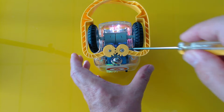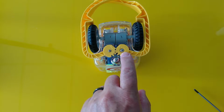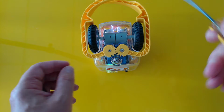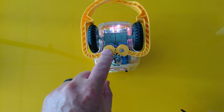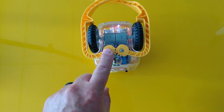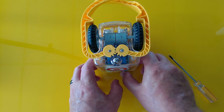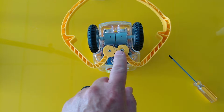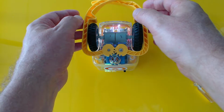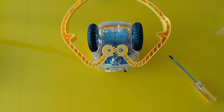So the first thing you want to do is basically just loosen this gripper. This is the follow gripper. What that means is this is the driver. There's a servo motor directly underneath this gripper, and this one just follows it. So now if we switch off and switch on, you'll notice the grippers open. Manually just close it and test again to make sure it's working okay.